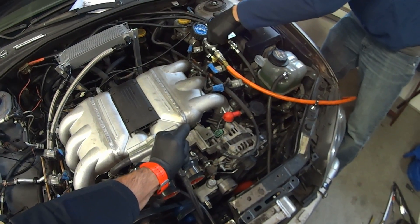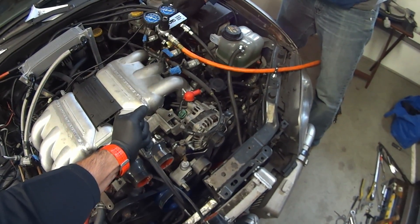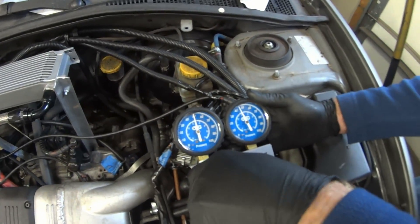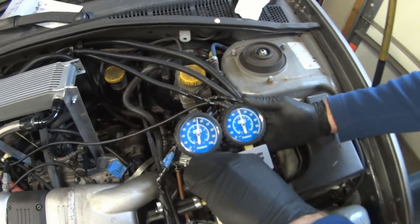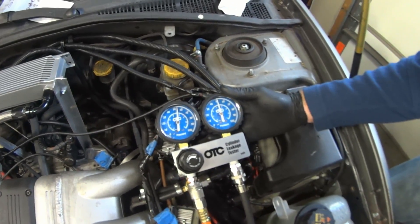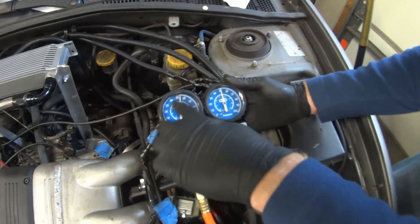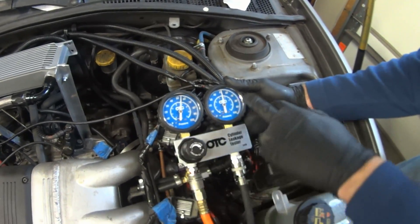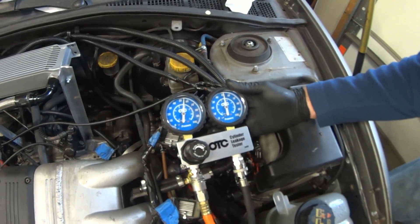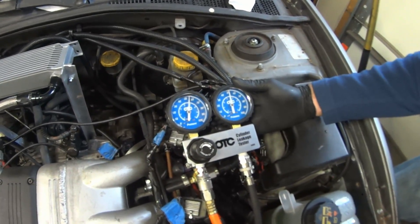So there's 30, 40 - let's see how this is right up there too. Yep, that's the way it should be. So that's a decent looking cylinder now. We've got 55 going in and the cylinder is measuring 51 or so. So that's holding much more compression than the last one.